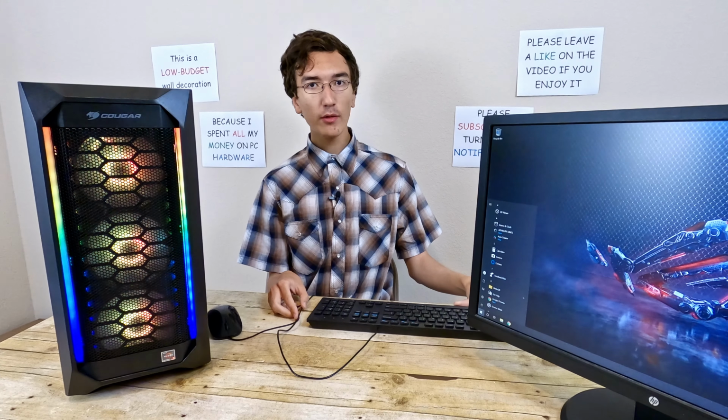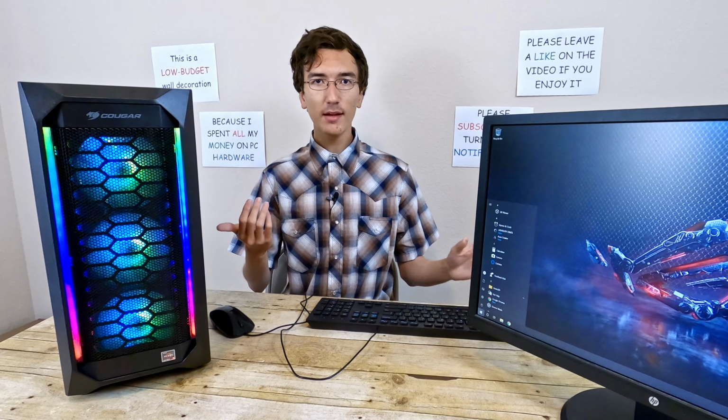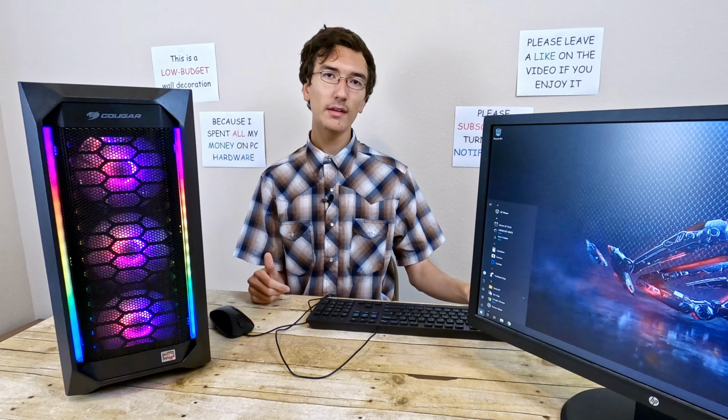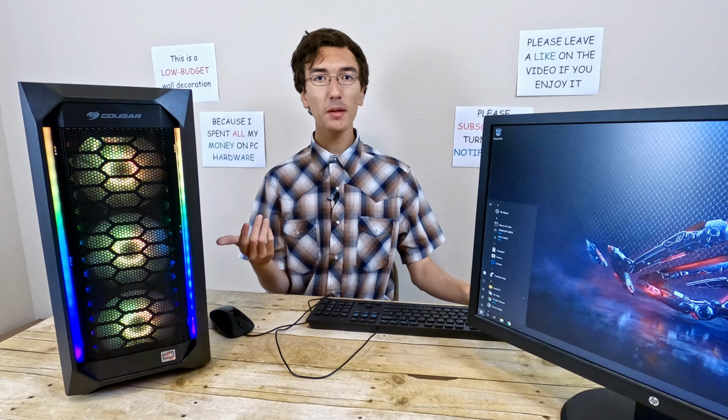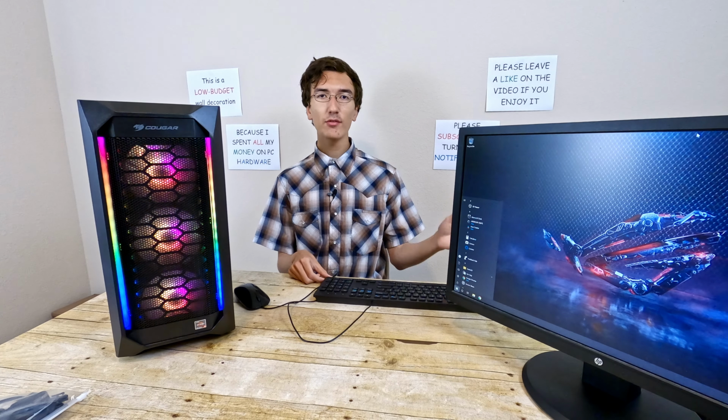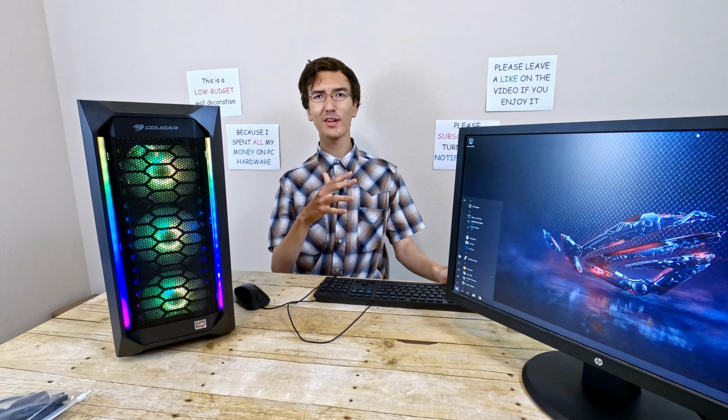So then I had to reinstall Windows and partition it to GPT, and then I realized that it had installed the boot partition on the hard drive instead of the SSD, so then I had to redo that to make it install to the SSD by unplugging the hard drive. And then after that, what happened is I got Windows running stably, but I couldn't update because an Nvidia driver that was older than the one I had installed over the newer driver, and so it just became a mess, and then a cumulative update wouldn't install.